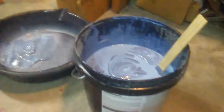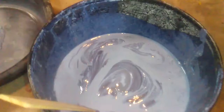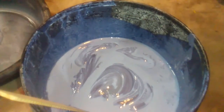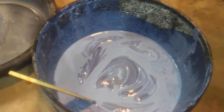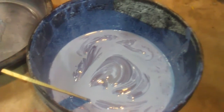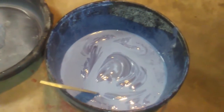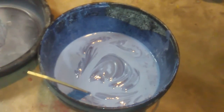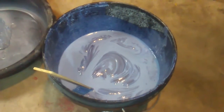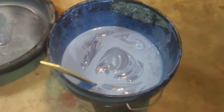I've opened my Lizard Skin — it's been about a year since I opened this stuff. This is the sound control Lizard Skin. I used this on Project Gym about a year ago and that's about how much I used doing two coats on that car — I did basically all the floorboards, quarter panels, hatch area, and all that. Looks like it's in decent condition, I just need to stir it up a little. It had just a little bit of dried-up skim on top after sitting for a year. Part of it is just keeping it sealed up and in good climate control so it lasts longer. I'm about to get it stirred up and get prepared to put this on Project Phoenix.